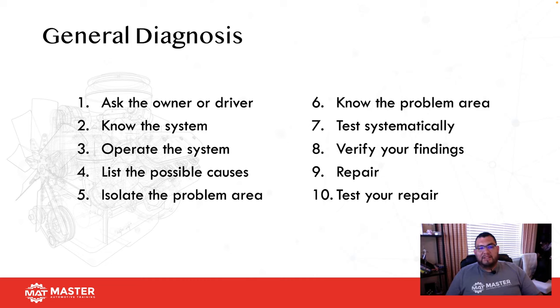So when we went ahead and tested the car, we did a dynamic test. We put our oscilloscope across the battery, started up the car, saw voltage drop, and then we saw the alternator begin to charge up, but it was charging pretty weak. Then when we did a voltage drop test on the terminals, we got almost 7 volts drop. What was super crazy is ground to the battery case, we got about 8 volts. So that means we had voltage on the plastic case of the battery. So we recommended a battery. And lo and behold, guess what took care of the problem? Battery and cleaning the actual terminals.